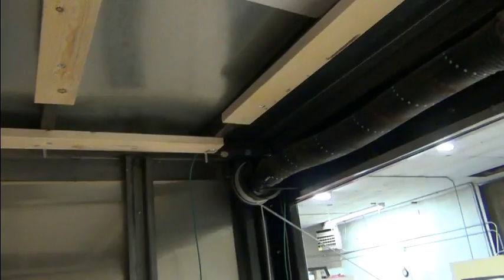The ceiling, they just put some furring strips that they were able to staple to. And let me tell you, there's no shortage of staples. You can see that this is a kind of U-channel that they're using. This isn't structural, this is just here to provide an attachment point for the skin. You can see the screws where they go through the aluminum skin, and then for our plywood attachment. That's the purpose of these 16-inch on center U pieces.